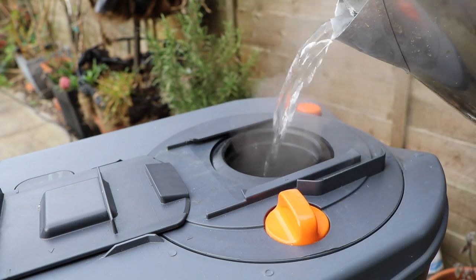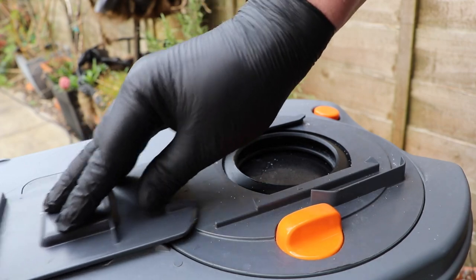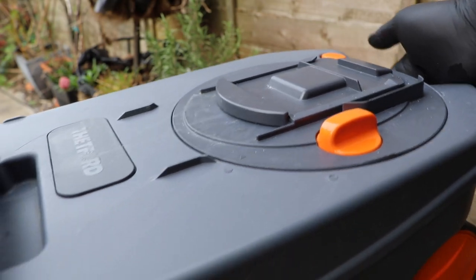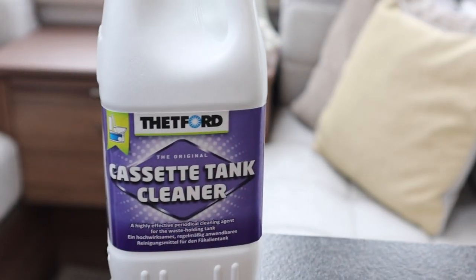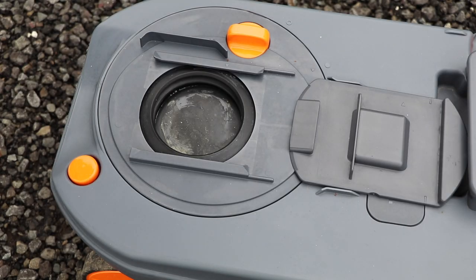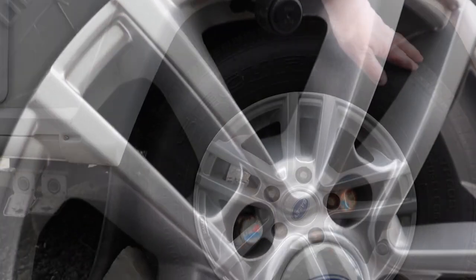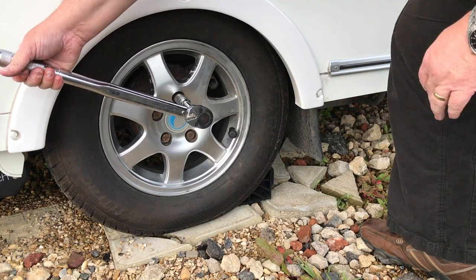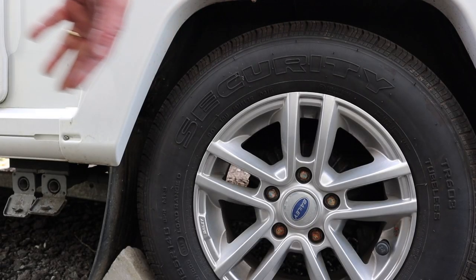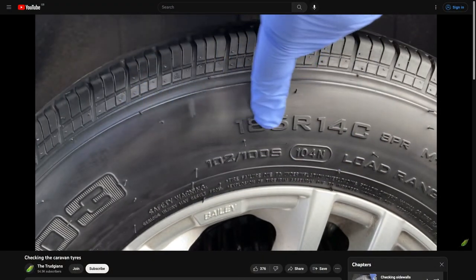Use very hot water in the cassette and leave it for around 15 minutes — this will break up and dissolve the residue. Slosh the liquid around before emptying the toilet, and repeat if the residue still exists; it can take a couple of goes if it's quite bad. Once clean, use a toilet cleaner such as Thetford cassette cleaner to disinfect the cassette, then finish off by spraying the seal with some silicone lubricant. It's important to check the tires every time you set off, especially the torques and pressures, but now is a good time for a really thorough examination, especially if the caravan has been stationary for a few months. I have a separate video on tires linked in the description.